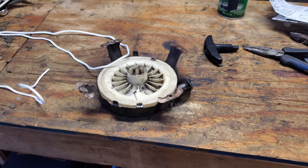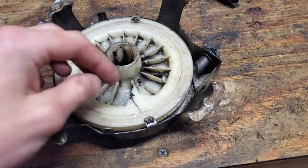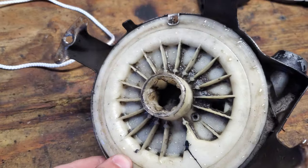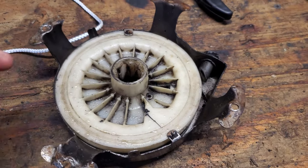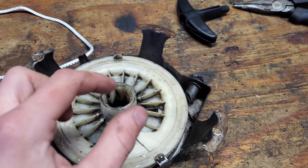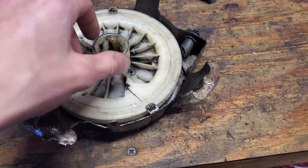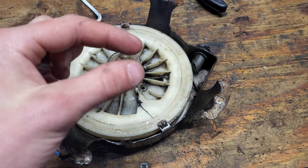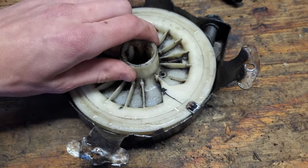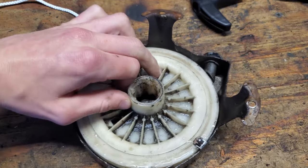This thing actually didn't have a broken recoil spring like you'd normally see - it kind of just fell out. The plastic looked chewed up, but the end of the spring wasn't broken. It was tapered and almost looked like it just clipped into the plastic, which explains why it pulled out. What I did was put it through and bend it back over itself so it's not going to come off. Now it's nice and springy and it doesn't feel like it's going to come off.